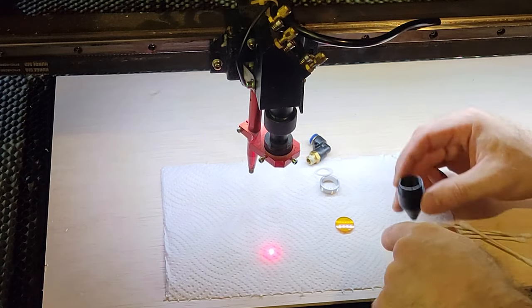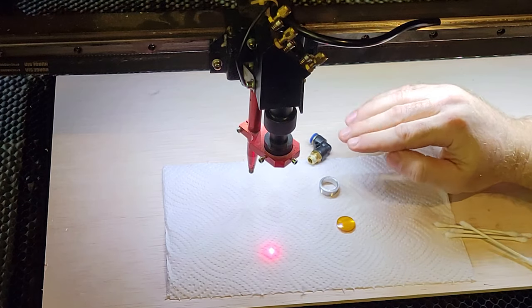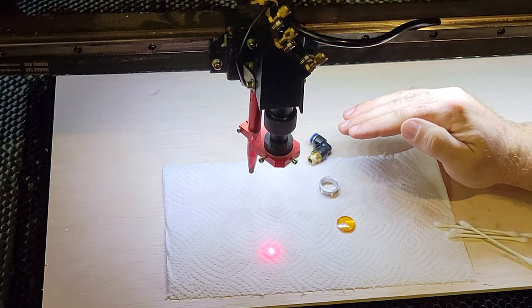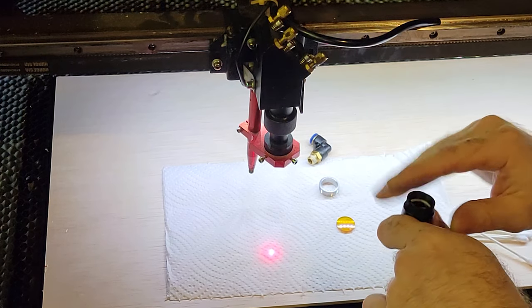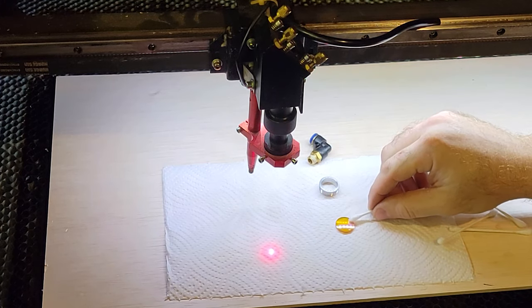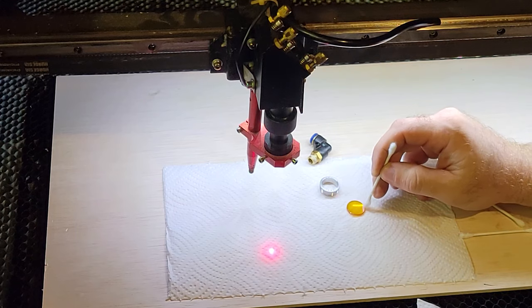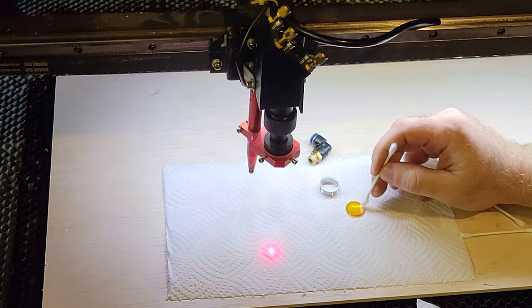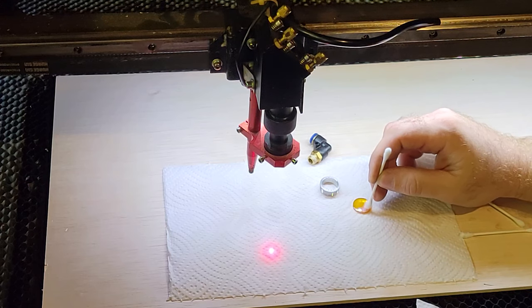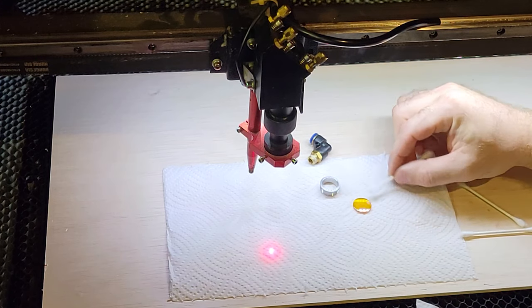So when you replace the lens, put this little plastic piece back in. The lens has a convex shape — like a contact lens on one side — and the other side is flat. What we want to do is put the flat side down so that it sits flat in there, and the hump raised part is up. A lot of times they are hard to see, but one trick: if it's laying flat and it doesn't rock, that's the flat side down. See how it's rocking? So this should be our hump side, our convex side.